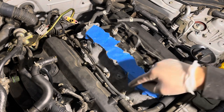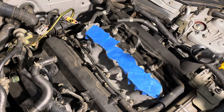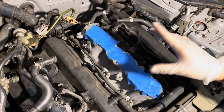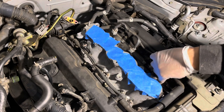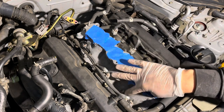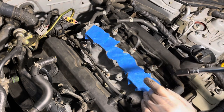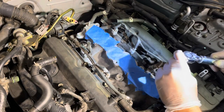I've cleaned all of the surfaces, put the new gaskets in to the bolt heads. Right now we need to torque down this lower plenum — also called the collector. There is a sequence and steps for torquing this down: there are four bolts and four nuts. We're gonna torque it all down to five foot-pounds of torque first, starting with bolt one, then bolt two, three, four, and then nuts five, six, seven, and eight. Then we're gonna do the exact same sequence to 19 foot-pounds of torque.